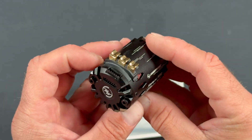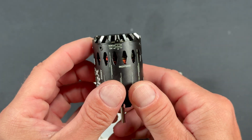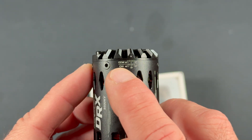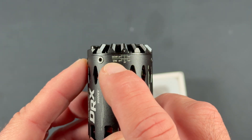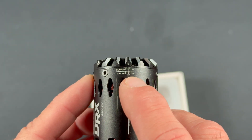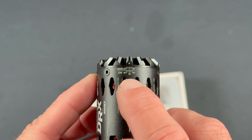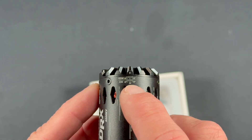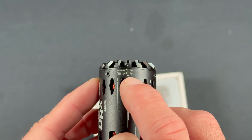Take a look. It's got the dual sensor ports for your different variations, and it does have the adjustable timing as well. You see here it's got counterclockwise CCW and CW rotations, and that is to adjust timing, positive or negative, whichever direction you go. There's no zero, so you start at 30, you can go down to 20, up to 40 type of deal.